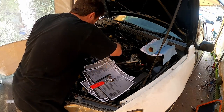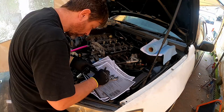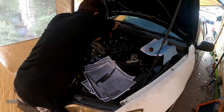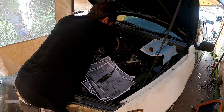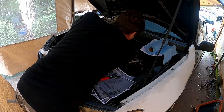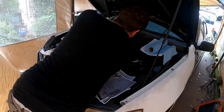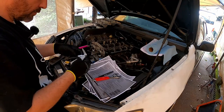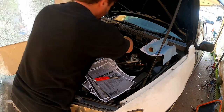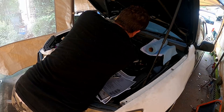That fit in quite easily. Let's try 0.2. 0.2 doesn't fit. 0.19. I don't believe my results. 0.19. Next one. Not overly difficult, just a pain in the ass. 0.18's not fitting in there. Try 0.17. I can't get 0.17 in there. This might be too tight. I might be changing one. 0.16? 0.16. That one's out of spec.